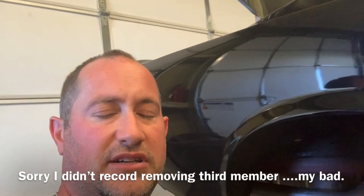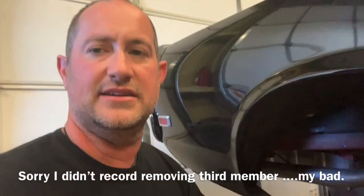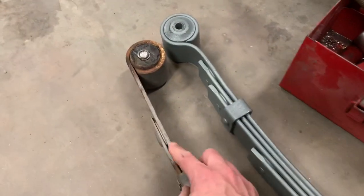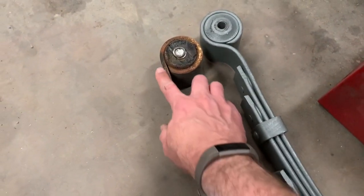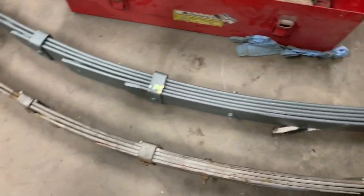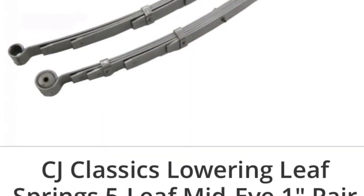Since I got the rear end out and the gears are totally thrashed, we are going to take the rear leaf springs out of this car and replace them with what they call a mid-eye leaf spring. I'll show you the difference — extra leaf, and they're also thicker. See how this one's curved down like that? That effectively lowers the car, while this one is just straight and curves around. That should lower the car a little bit. Looks like it's probably going to be a stiffer ride. Hopefully it ends that spring wrap problem I've been having.